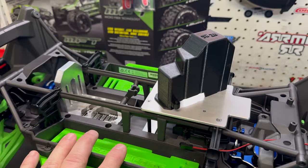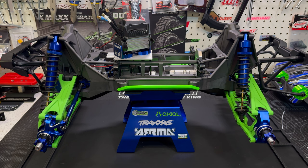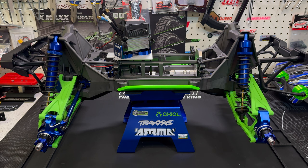There you have it. I hope if you're new to the X-Maxx world, you found this informative. I'm not kidding when I say: brand new X-Maxx out of the box — pull your motor, get rid of those pins, and properly mesh the truck. I'd even say if you're buying a brand new X-Maxx, buy an aluminum motor mount and those motor mount washers and get it done right. Even if you have to ask the store to do it, hopefully they'll cut you a deal because you just bought an expensive truck. This is now my fifth X-Maxx — I've run them since the beginning of the 6S to the 8S upgrade kit and a few more in between. It took me a while to figure out that was the problem. I'd go out and not even get through one run without destroying a pinion, a spur, or both. The day I pulled those pins, it was life-changing when it comes to an X-Maxx, as cheesy as that sounds.